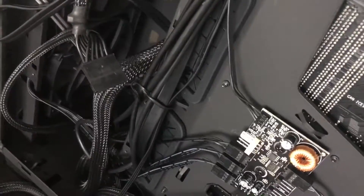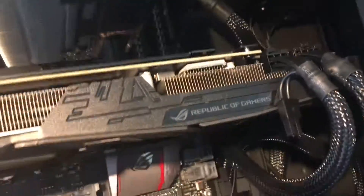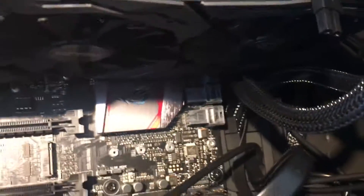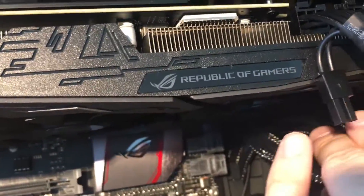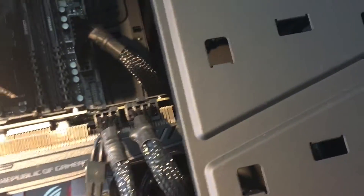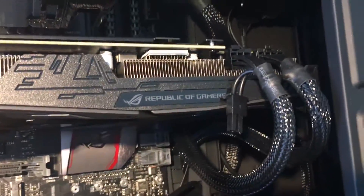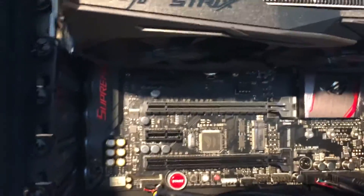I'll just run these through one of these ports and we'll connect the graphics card now. Alright, there we go. Here it is inside. I did actually run the cables through from the bottom slot, not the one over here — it just fit better that way. Now, how you guys install it: it's actually a couple of millimeters bigger than the case I'm using, which is the H440 from NZXT. So this panel here kind of blocks it. What you can do is just slide it in through this corner first, and then just fit it in there, because you do have some room to adjust things inside.